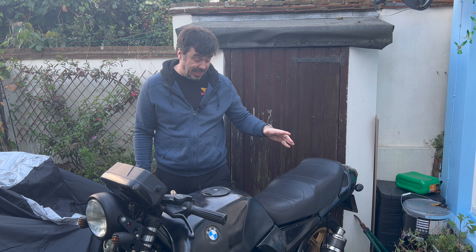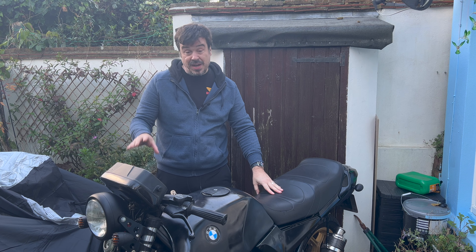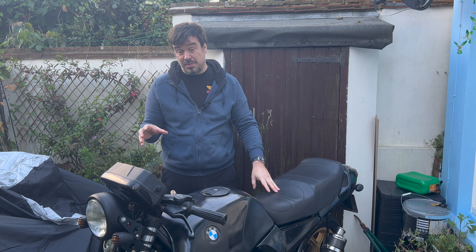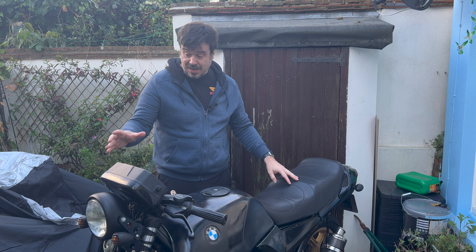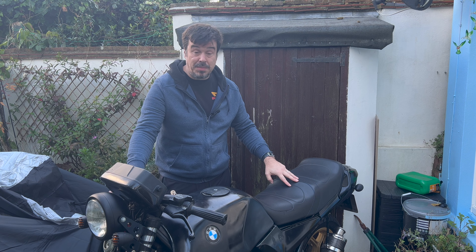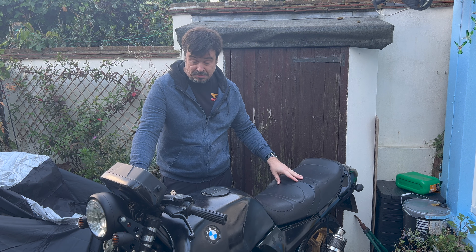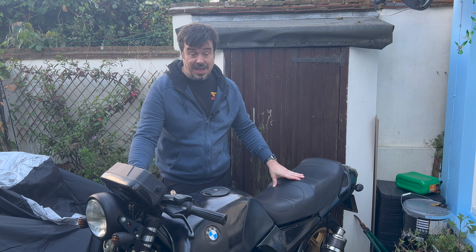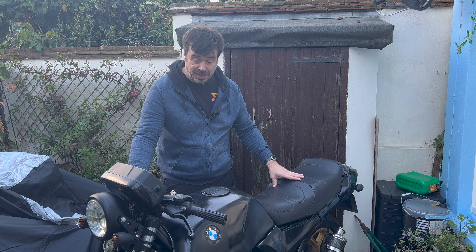So that's pretty much everything I've done so far. The big wins realistically are repairing the battery and finding out what's making the calipers stick — it doesn't look to be the pistons but more the pins everything was running on, which is going to be around 20-30 quid to replace. If I'm doing those I might do a full caliper rebuild. I'd like to find out next when I bleed the brakes if the front master is working — the rear is perfectly solid — so I just need a couple of hours of dry time to get that bled nicely.